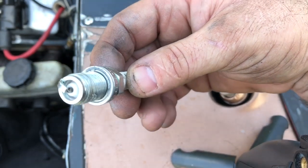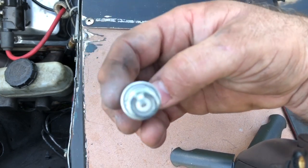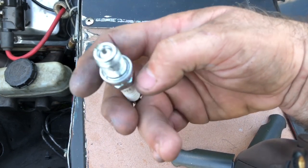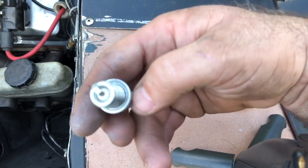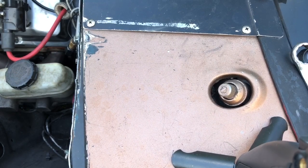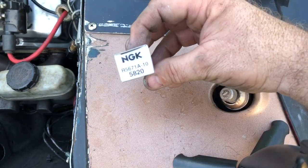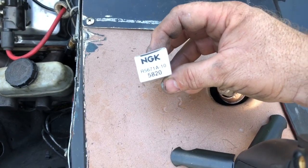It could have pre-ignition to where it actually lights off before you even get the spark, and that's catastrophic when it does that. So heat range makes a big difference. If I had number 11s in all of these, they would all look a lot colder because the metal is not going to get as hot. That's how we look at the plugs. You can pick up these NGK plugs - usually get ours from Rock Auto. They're really cheap, like $1.50 to $1.59 a piece. That's how I do my spark plugs. Please like, comment and subscribe, and y'all go fast and get some win lights. Thanks.